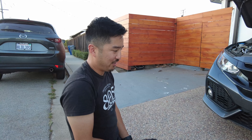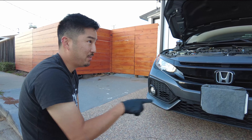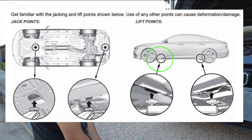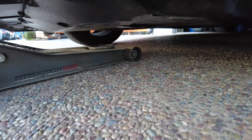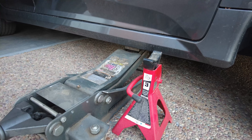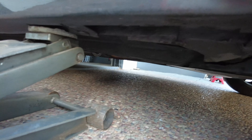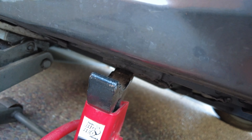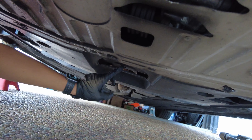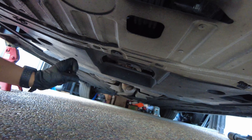First we're going to jack up the car. There's a metal plate underneath that we have to take off first to get to the oil. Straight behind it there's a metal point that you can use to jack up the car and then put the jack stands on the sides. If your floor jack isn't long enough you can put it a little off to the side. If you can get the jack stand just right at this metal point exposed underneath the trim, you can jack up right here.